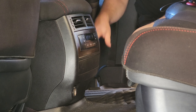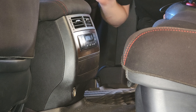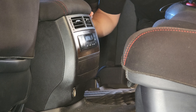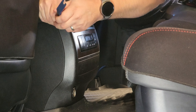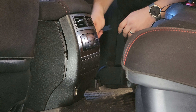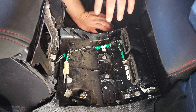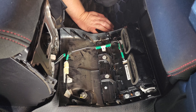So the first thing you're going to want to do is move your front seats as far forward as possible. This just makes everything a little bit easier with your access to get into the car. Once your seats are as far forward as you can go, you have a bit more room. This back panel is not held on by any screws — you can just pop it off whenever you want to. So I've just got a trim removal tool, basically I'm going to put it between this outer panel and the actual centre console and just push it through, and you'll find the whole thing will just remove from the back of the console. You can remove this from the car completely if you want to — there are obviously all these electrical plugs and stuff to take off but you do not need to.